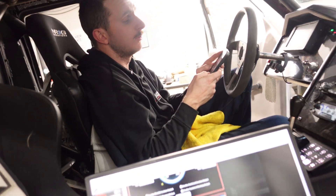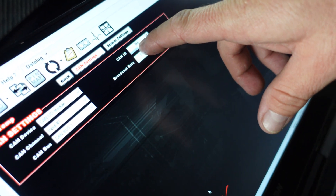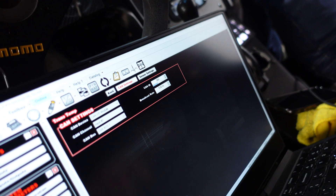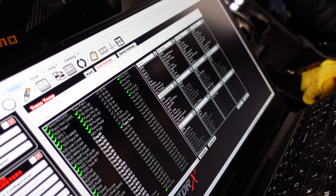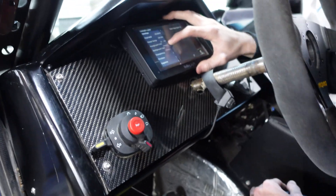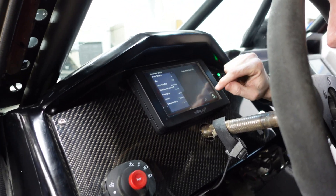Mark's been on his phone like always. What's the next step? I guess we just try this and see if it works or not. Save it. Send it. Mark, I think we did it. It said $8.66 but there are still no instructions for this, so we fumbled around like monkeys. So I guess this is the video on how to set these guys up, as long as all this is right. I came over here to the data monitor, scroll over, find our trans temp, add it to IO box, and it worked. After some fun 7-inch dash updates, now we actually see our external IO on the dash without any error messages.